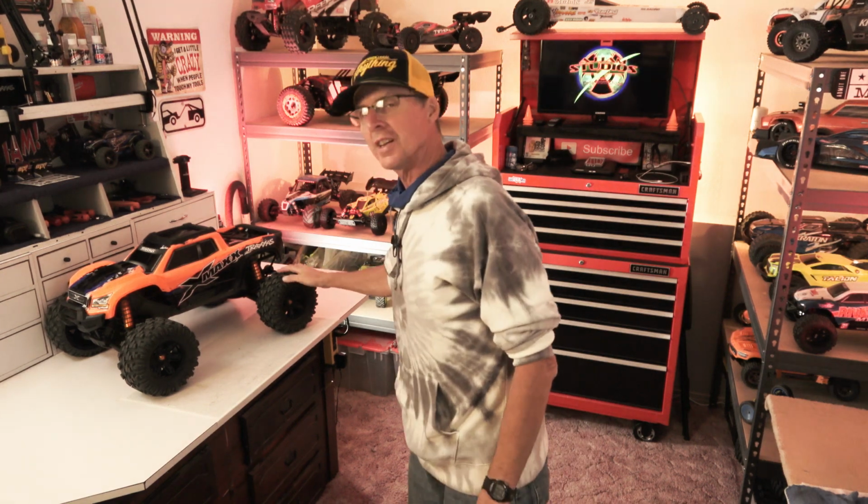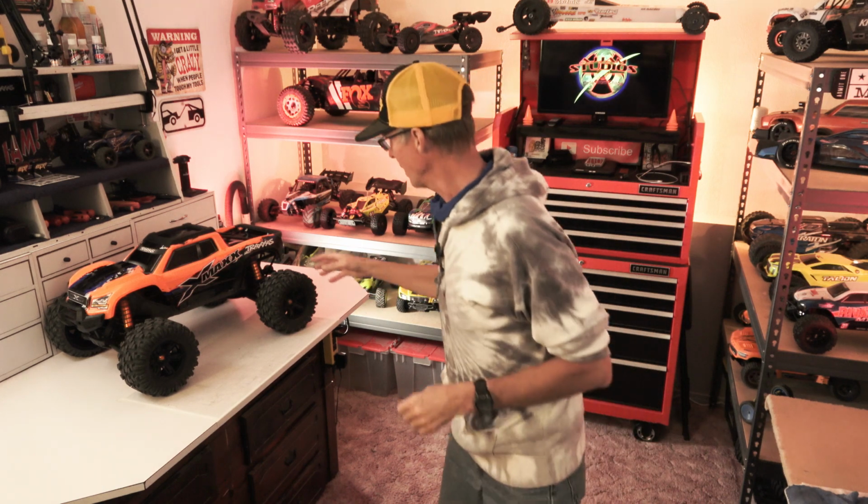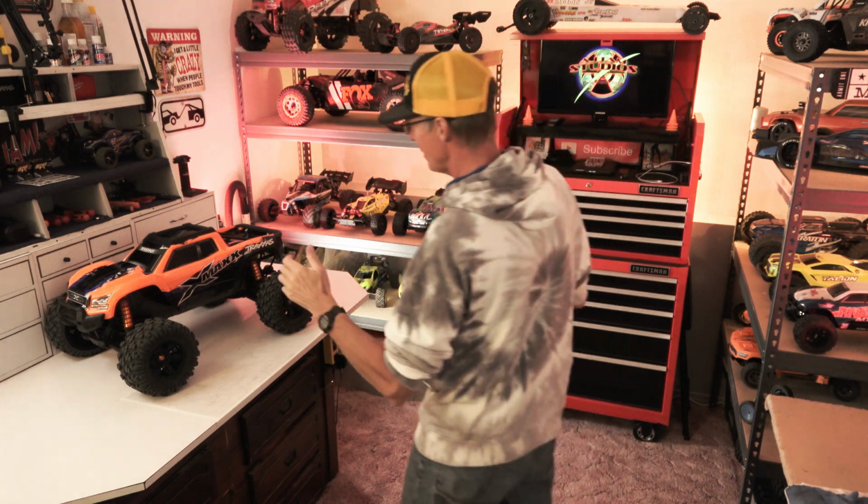So just to touch on the tires for a moment, these aren't overly expensive considering their size, but I still think they're the best tire for the car. Weight and power, it can handle both. However, they do pie out pretty thin when you get that RPM going, and it's hard to find a tire that can put up with that. I've even blown belted tires on some of my other cars when they spin up so fast that the belts can't even hold them up and it pops them. So these tires, I think, are still the best tire for the car for all around use.